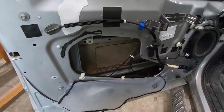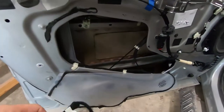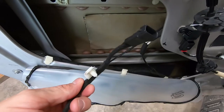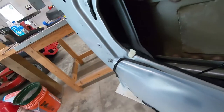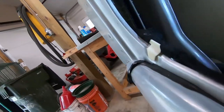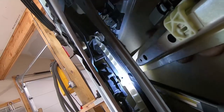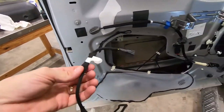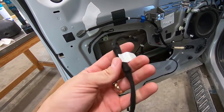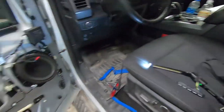After battling this for a while, here's what I've found. These little Christmas tree connectors — one was pretty easy to get to right down here. But the second one is way up inside in an area I can't even show you — it's up behind the window track, actually clipped between the window track and the reinforcement plate. There's no way to get that thing out of there. So I finally just popped the Christmas tree loose from the wire.